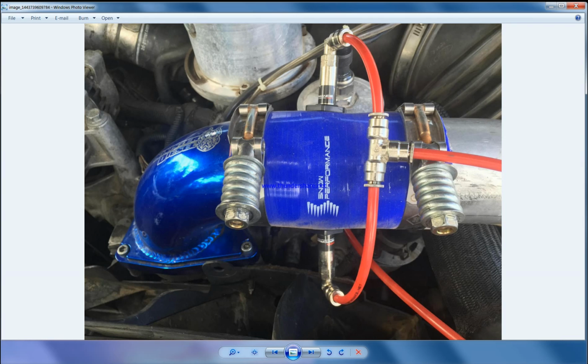From my experience, 80-20, 80% methanol and 20% water, or 70% methanol and 30% water, is a good thing on modern cars. It's all about atomization. If you don't have atomization, it gives a misfire on the car. That's the problem. So there are lots of things based on the car, the model, the nozzle size, and the location, which I will be discussing in part 2.